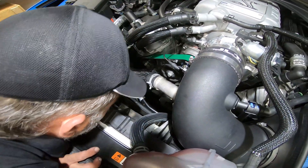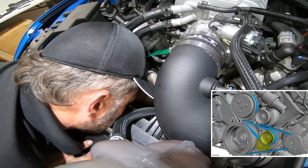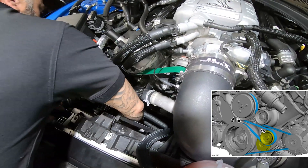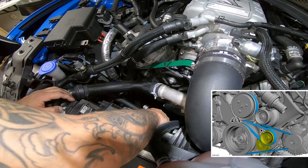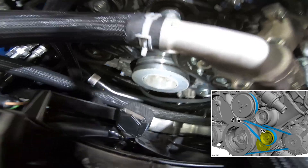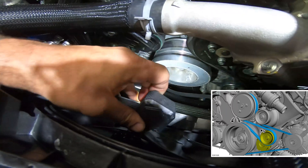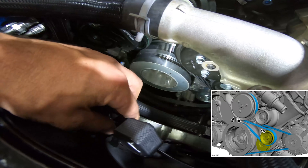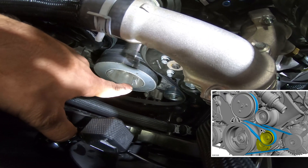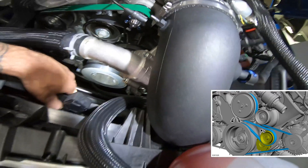This is the trickiest part left, and I'll put the belt routing up on the screen. If you look down in here — you go up underneath the water pump pulley, it wraps back around that tensioner, then back around the crank and over to the alternator. Let me go ahead and get it set up and we'll try to show you an after shot.